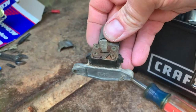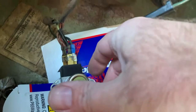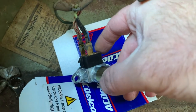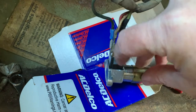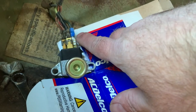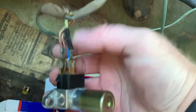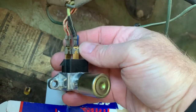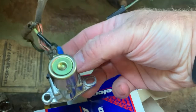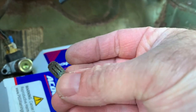Until today. This is the old switch and it's got some problems — this is where the power comes in. I've got the new one over here, kind of wired up. The previous owner did take out the connector, so these two are the original pins that would have been in the connector. This one I just had to install — I have a little kit. Someone did splice this at some point; this is supposed to be a black wire. The battery is unplugged, by the way — all bare wires right now. Someone spliced in a green wire.